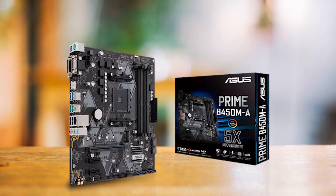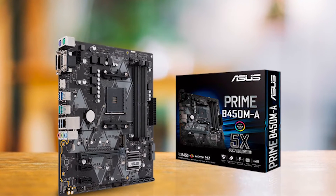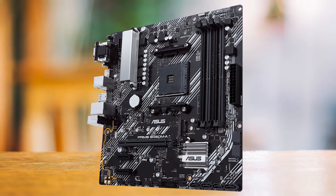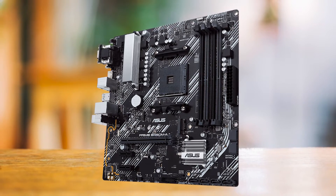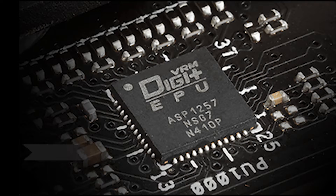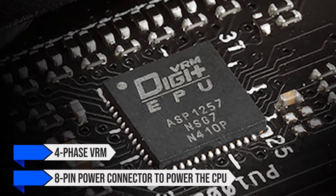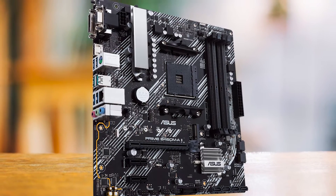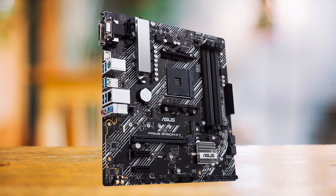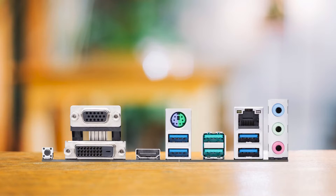This board is not like the original Prime B450M-A, which is not an impressive motherboard and is actually more expensive. The Prime B450M-A2 fixes all the issues with the original and is one of my top picks for budget 3000 and 4000 series motherboards. The board has a simple four-phase VRM and requires an 8-pin connector, so any AMD CPU with up to 105W TDP will run at its maximum potential. You could even upgrade later to a 5800X3D and run it at stock speeds.